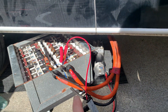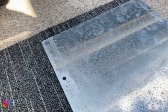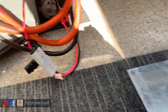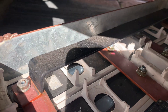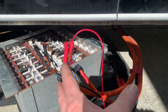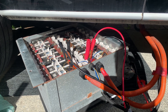Taking a quick look at what I said about these batteries not being restrained — they're just sitting in the box. We've taken a little bit of foam and slid it up between the two batteries. There are no witness marks on the underside from them actually hitting, but I'm still genuinely concerned. It does have standoffs on the batteries to protect from hitting the top, and there's tape around the bus bar at the back, but they could still move substantially under g-force load.